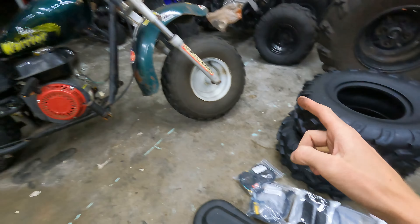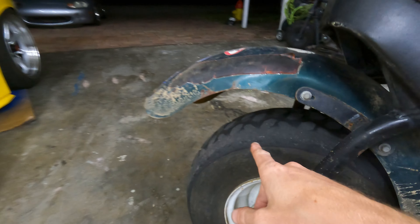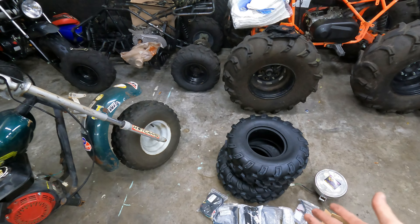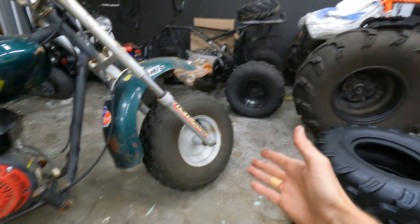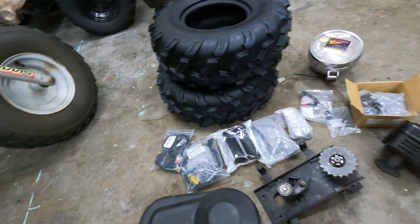I picked up some brand new rubbers for the front and back because the rear tire is basically smoked — the outside has no tread but the middle does. I think the fender was just rubbing on the tire for a long time. I ended up buying a set of tires because it's cheaper to buy them in bulk. The front one was almost bad too, so why not replace both. I got some nice knobby tires since she's going to be using this thing on trails — more of an off-road vehicle — but still pretty smooth on the road.